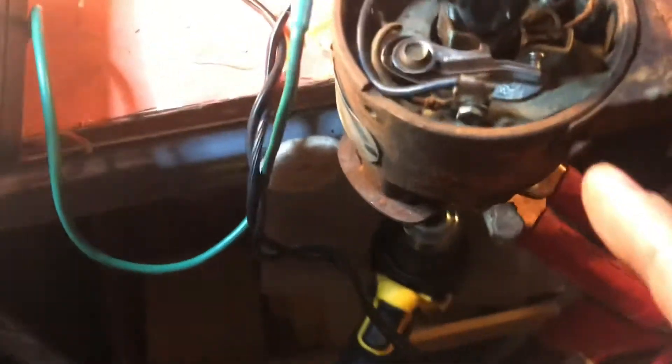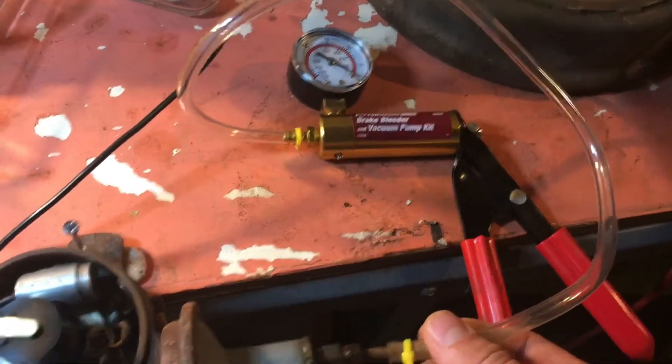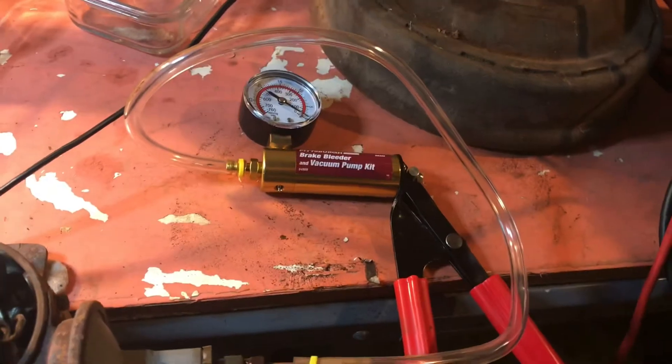The points are connected to the body. I have a half-inch drill here which I'm using to power my system, and I've connected a vacuum pump to my vacuum advance. That ultimately grounds this circuit back to earth — I just connected it to the body here, which works pretty well.